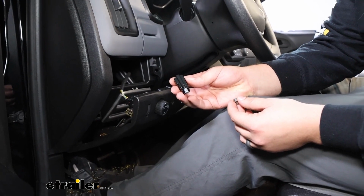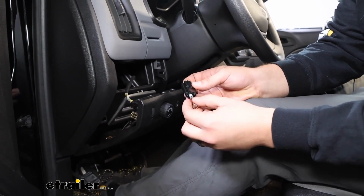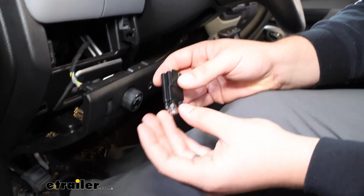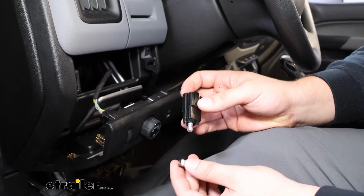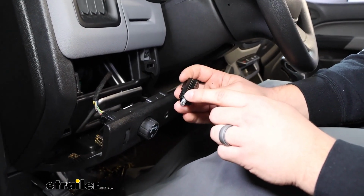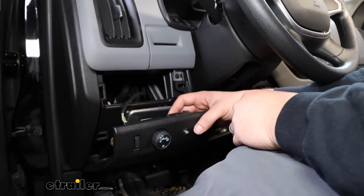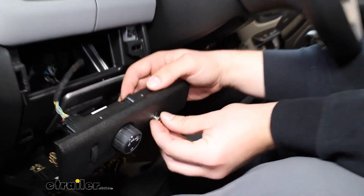You can then take the connector for your switch, that's the back of it, and here's the front with the dial, and the nut. These two will thread together very gently. It's got a very low torque spec on it. Hand tight is going to be pretty good. But pass this through the hole we just drilled with that small LED light up top going through our smaller 1/8" hole. And we should see the knob go out the front there.